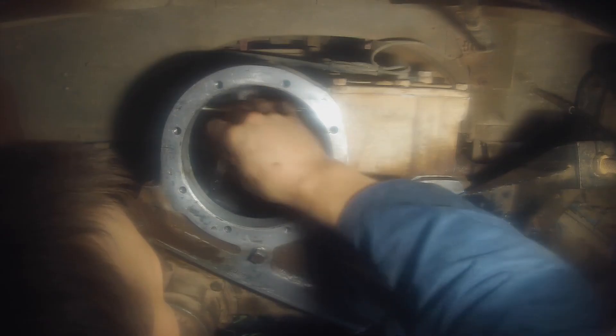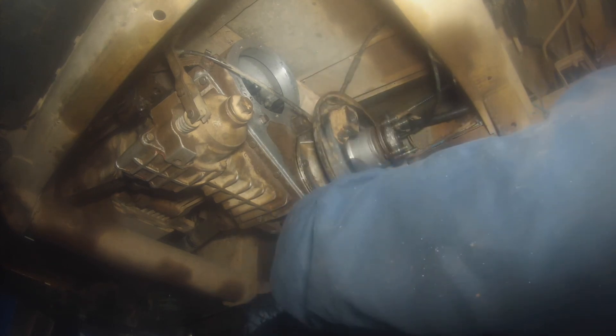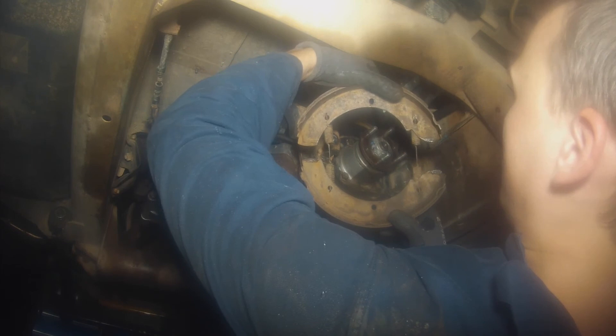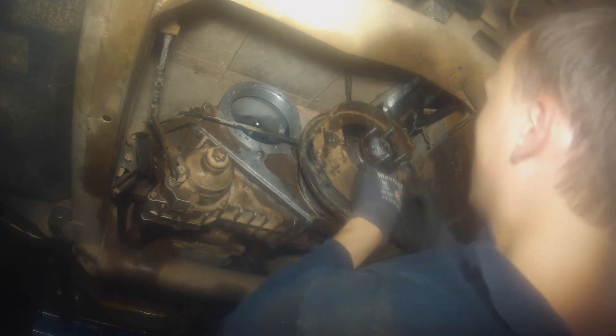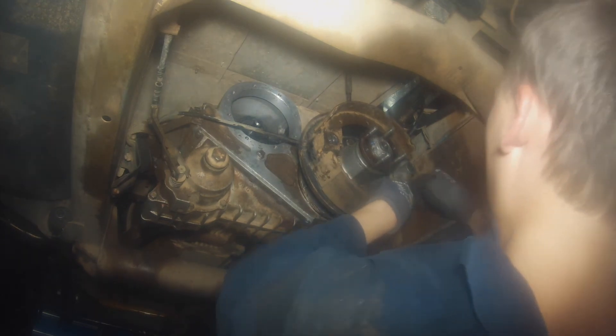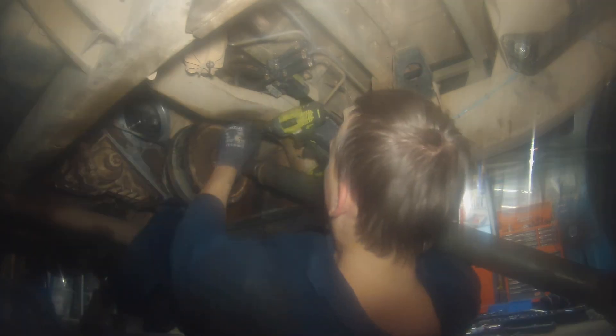Now we can refit the bottom of the case. I could reach in, grab the chain and run it around the sprocket — quite fiddly but a doable job. I've left the bearing cover off for now to make it easier to fill with oil. Next up we've got everybody's favourite job: the brake drum shoes. I find it's easier to sit the top shoe in first and then use both hands to pull down on the bottom shoe and slot it into position. We're pretty much done. This is the prop shaft nut tool I really like using — it's 9/16 so it fits properly and you can get in there with the drill; it makes this job much more bearable.